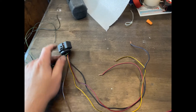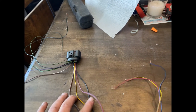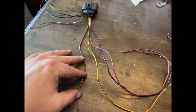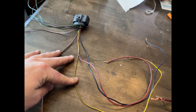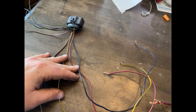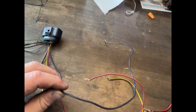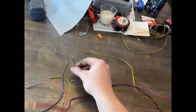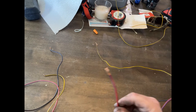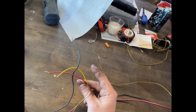Here is the T14 connector in the engine bay, de-loomed. We're running four wires right now: a solid thicker brown wire going to chassis ground; a yellow-black wire getting 12-volt power; a red-lilac wire getting 12-volt power; and a darker purple wire also getting 12-volt power. On the brown connector: a yellow-black for 12-volt power, a purple wire for 12-volt power, and a thicker red-black wire also getting 12-volt power. This is the main power for the ECU and the sensors on the engine.